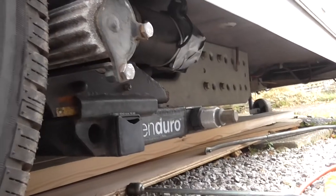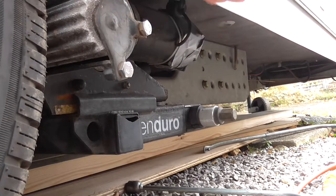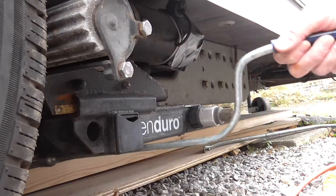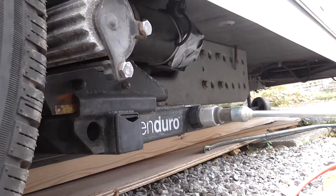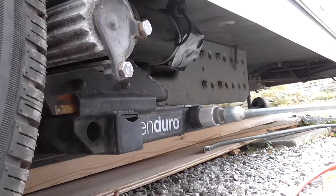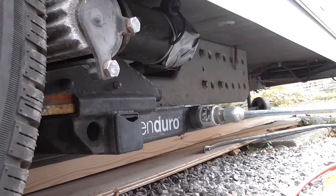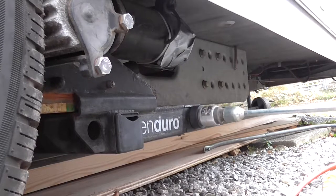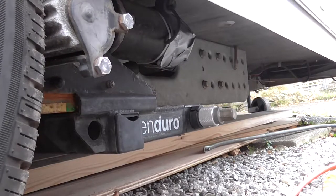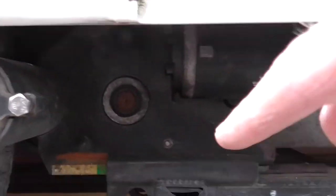Next, you need to wind the motor wheels onto the tyre. I've done the other side but I'll show you this side. Take the caravan mega winder for the corner steadies, put it on here, and wind that wheel towards the tyre — see it going in here — until it's tight up against the tyre and engaged, like this.